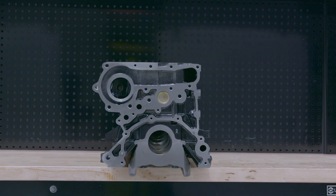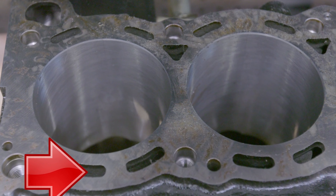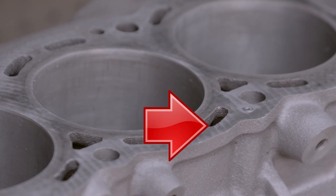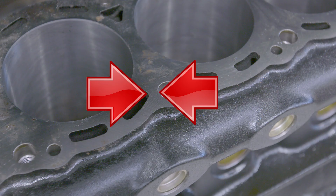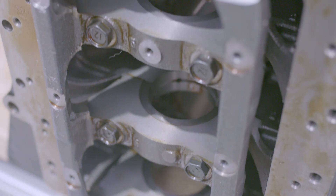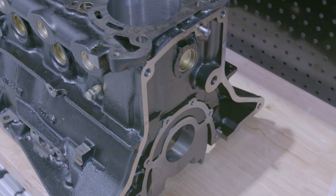On first physical inspection the GT block appears to be no different to the N1 block. Looking closer at the water galleries, the area where the bore meets the deck does seem to expand out smoother with a little more material compared to the right-angle join in regular RB blocks. We were told the distance between the water gallery and head stud holes gives more meat on the N1 and GT block, but after measuring all the RB blocks, the distance is not consistent and there's no real difference. We were also told there was more material around the crankshaft, but nothing measured validates that claim — if anything, the area around the crank at each end is thinner on the GT block.